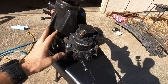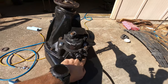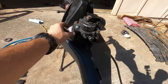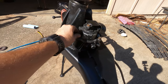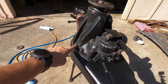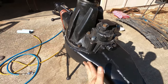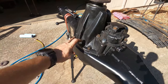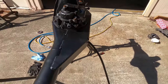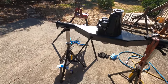The third member is on. We did have to redo the hole here on the axle - it wasn't perfectly aligned so we put a new helicoil in there. We also had to drill out both of these holes a little bit wider for better alignment. For the most part everything else lined up, though these were super tight on the outside. These are going to be my drain plugs - I took the whole drain plug off the bottom and now I'm putting bolts in there that I can pull out so it all drains out. Only a few things left: axle shafts in and the breather grommet work.